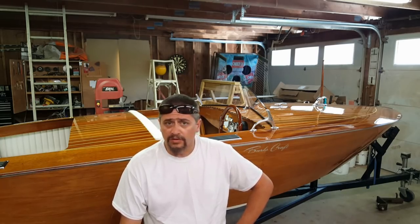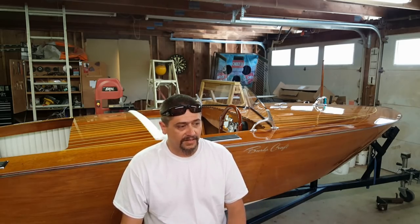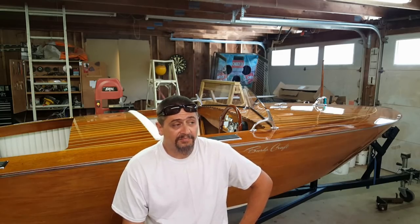So I pull into that grocery store parking lot, and I get out, and I'm just checking tie straps front and back, checking to make sure that my trailer ball latch is locked and secured. Again, checking trailer light connection. I'm feeling the hubs to make sure that the bearings are cool. Half mile from my house. I hadn't been in that parking lot